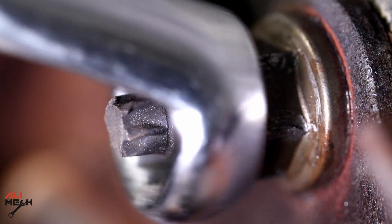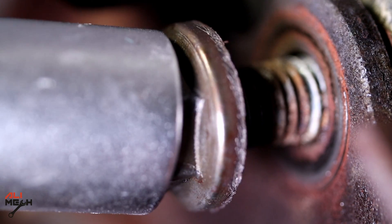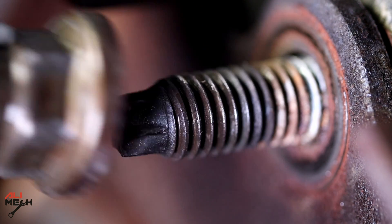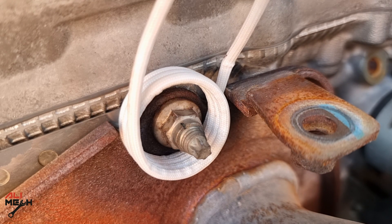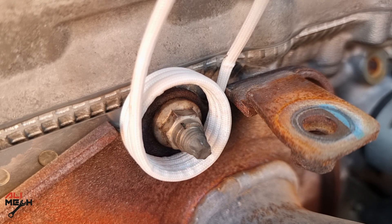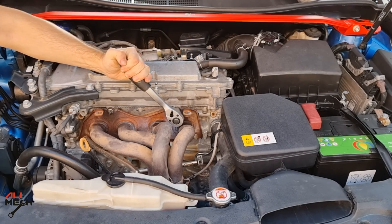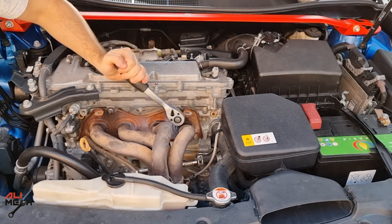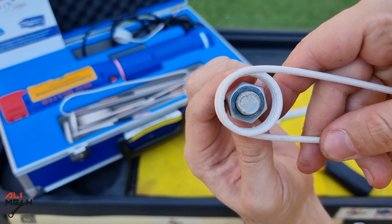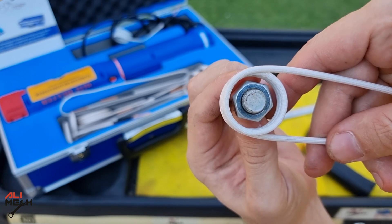It really made it so easy. Just imagine if you don't have this tool and you break that stud — how much it will cost to replace that stud. Alright, we're gonna do the same procedure on the other side, even though I didn't use any WD-40 for penetrating. This is not real-time speed — I didn't want you guys to watch that scene for 25 seconds. But at the end of the video, I will leave you guys with real-time and showing temperature as well. This is so satisfying and easy for undoing exhaust nuts. One tip I can give you to keep the heat consistent: keep the nut in the center and not touching the sides of the wire heater.